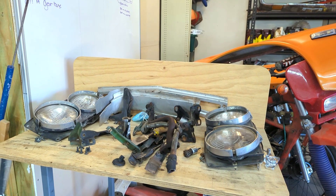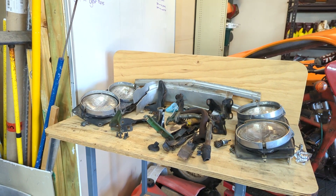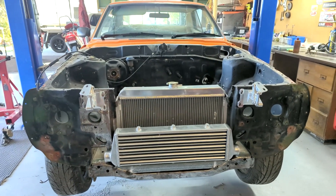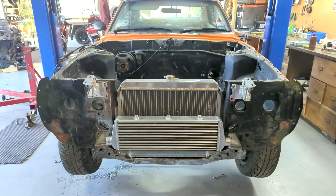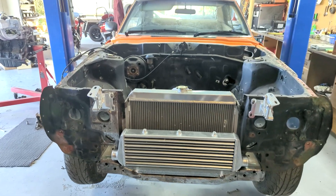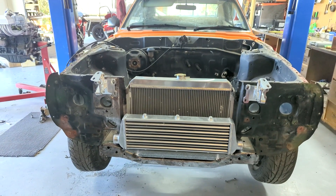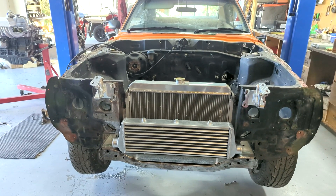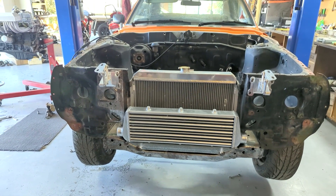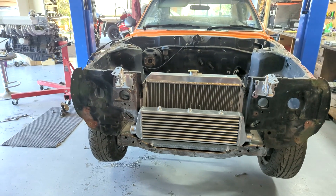There's heaps of front end components — lights, old hinges, a few turbo pipes sitting in here — just everything to clean that front end up. Anyone with an RA23 or TA22, similar model — same in a lot of ways. They didn't come out with the 1G GTE motor in them, but it was a pretty standard upgrade in the past, and that's the way I bought this — all done up that way, but done reasonably roughly to get it running. I'm setting up a new intercooler now — it's not huge and I may have to review that in the future, but it is bigger than the standard one that was on the 1G, in whatever car it came out of — Cressida or one of those.